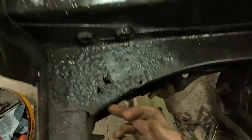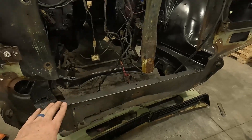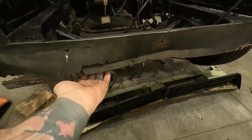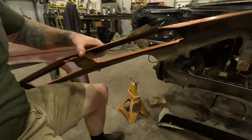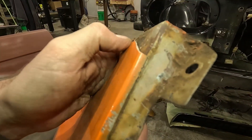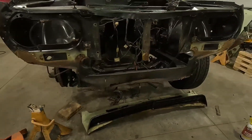I'll make a repair piece out of probably 18 gauge, cut here and run it all the way over, then do a seam weld. The whole lower core support is rusted too. I've heard that when you put an intercooler on these cars you sometimes have to modify this lower crossmember anyway. The frame rails all look good — it's just this section that got smooshed. I'm not going to focus on rust repair right now; I'm going to get back to stripping the replacement valence, which is much nicer but still has dents and a lot of bondo.